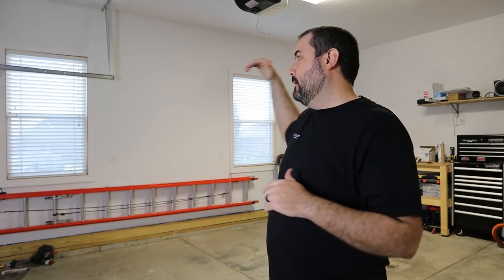So other things you may want to consider if you're going to put a lift in your garage, obviously ceiling height is the first thing. Can the lift fit in your garage, plus the lifting height that you want to achieve with the car on the lift? The RX-7, the Datsun, I can probably get the full height out of it, provided I've got the garage door shut for now. My BMW, I might be able to get 5, 5.5 feet of lift on that before I start getting too close to the ceiling. So that's the first thing to consider.